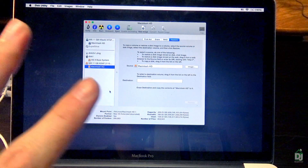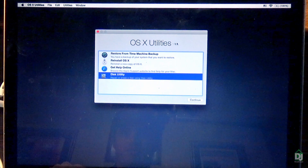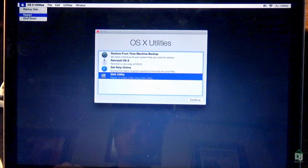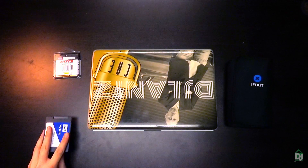We'll talk about how to take the hard drive out and put the SSD in — that's the easy part. This whole process is really easy. Once the restore is done onto the SSD, close out of Disk Utility and shut down the laptop entirely. Then unplug the USB cable leading to your SSD. Now that we've restored the hard drive to the SSD, we can begin to open up the laptop. Flip it over and open your iFixit kit.